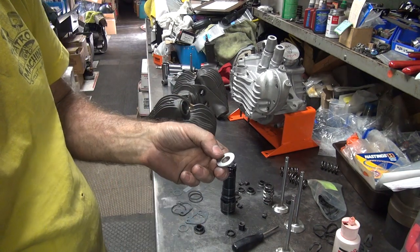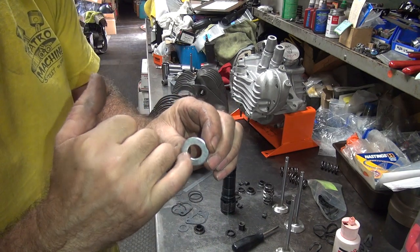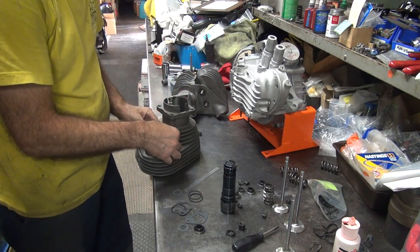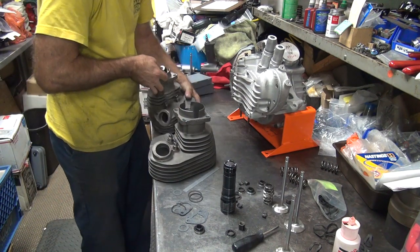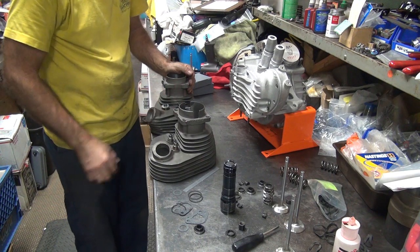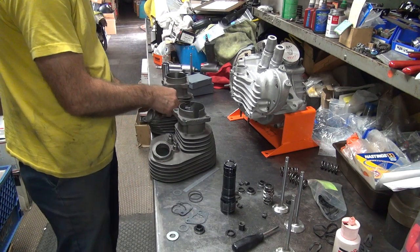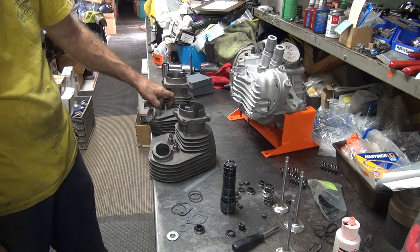Oh yeah. It's about 35 thou, so it's 32nd too tight here on the ID. So these in here should be okay on that one. I think we're okay on the OD. We just gotta find something that'll fit. I like that one because it fits in there right now. Fits right there.